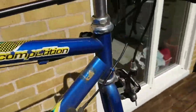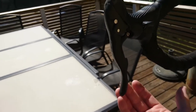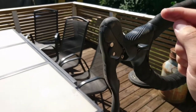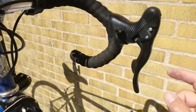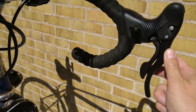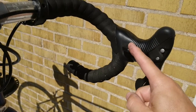If you don't know the Campagnolo shifters, they have — instead of Shimano which has the brake lever and the gear lever — this has the brake lever, the shifter for lower gears, and then a button for higher gear or smaller sprocket. On the other side, it has the brake lever for the front, the shift lever for a higher gear or bigger sprocket, and the button for a smaller sprocket. That's the difference between Shimano and Campagnolo.